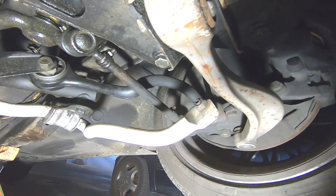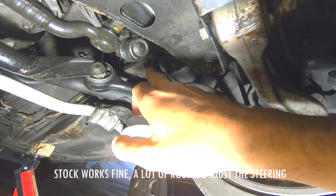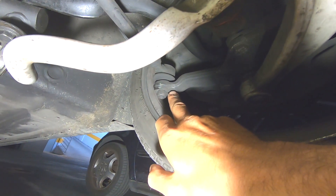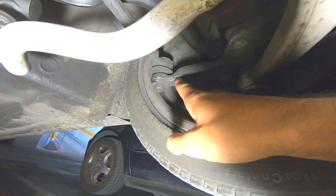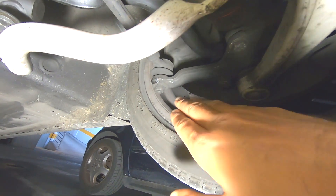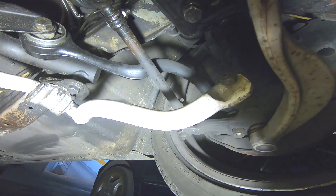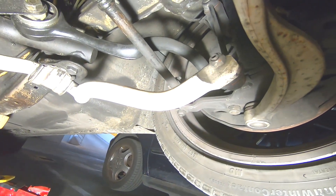I have to lengthen this one — I need to check if the rod is long enough, otherwise I have to cut it and make it longer. The knuckle I'm gonna cut a little bit and change the Ackermann just a little. I've seen people doing it a lot shorter but then there's a lot of conflict between the arms, the steering rod, and the rack, so I'm gonna do a test and show you.